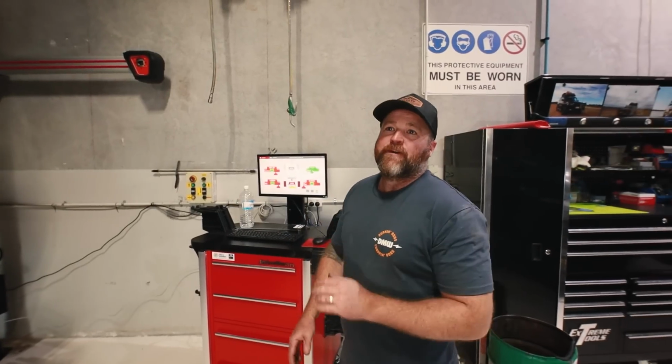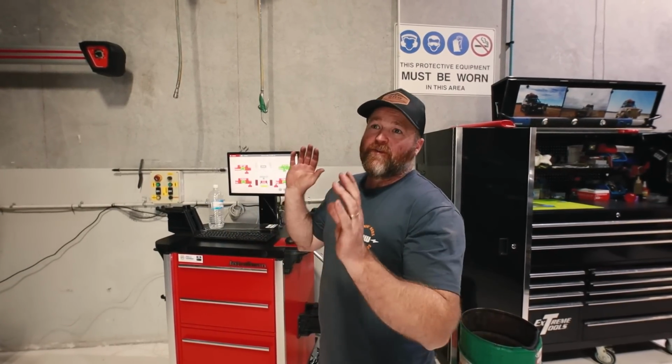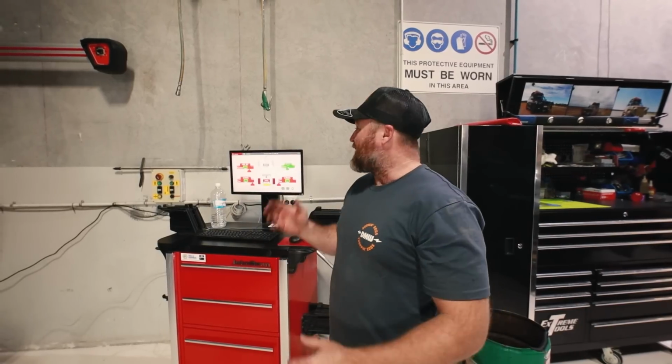There you go. Weight makes a huge difference to your wheel alignments if you've got a ute. That's why we got it pretty close to take it for a bit of a drive to begin with, and then obviously the canopy's going back on it, so it's got a fair bit of weight in it, as we know, and that's when you've got to do a proper wheel alignment, because if you're going to do heaps and heaps of Ks with weight on your car, make sure you get it wheel aligned for that correct weight.